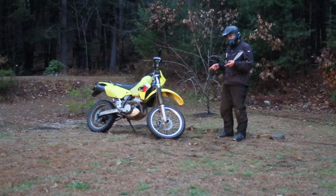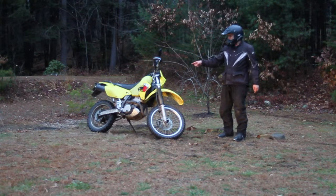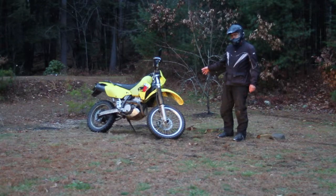What I can't speak for is how this would happen after an hour's worth of hot riding. This is fresh fluid in there, fresh 5-weight fluid, right at the factory specs, which is 165 millimeters from the top, or 6.5 inches from the top, brand new fluid. Original springs. Previous owner had Race Tech springs in there, they seemed too hard to me. Might try them again in new shocks, hope to see what happens. But for now, so far, with full spring preload on, the shocks like to have full compression as well, at least over the sharp edge, slow speed stuff.